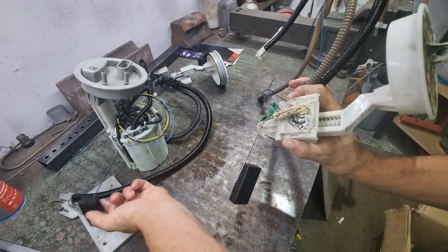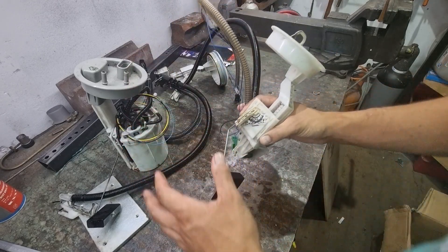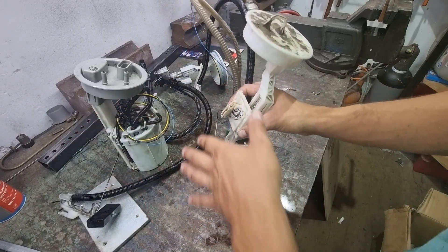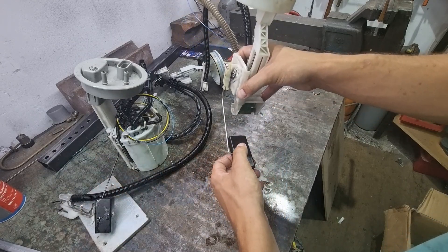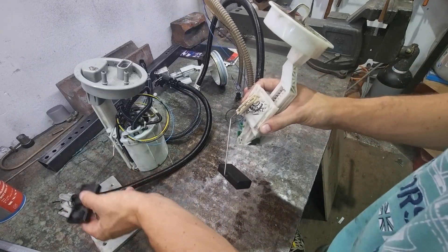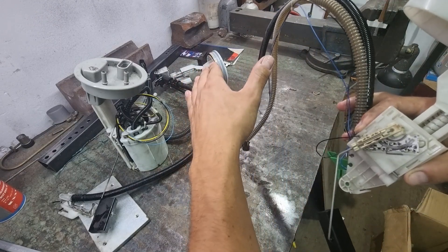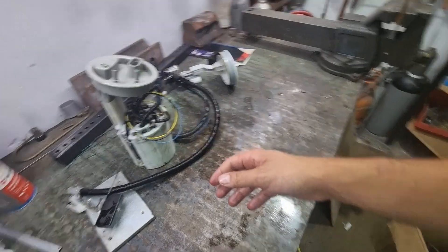You have a fuel sender unit — one on the left portion of the tank, one on the right. These resistances combined equal the resistance read by your fuel gauge. They are calculated together because, for example, when the car turns left, fuel goes into the right half — this sender lifts up, this one goes down — and you always get the correct reading on your fuel gauge. If you only measured fuel in the right tank, your fuel needle would always jump around.